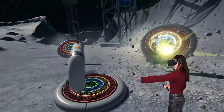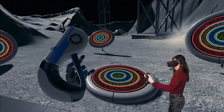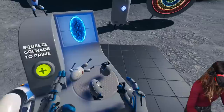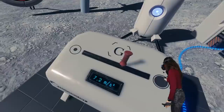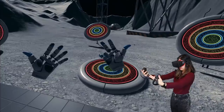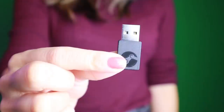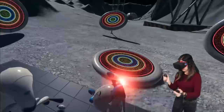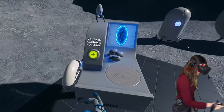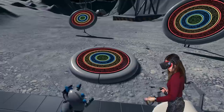So let's talk about the catch. Since the Knuckles work with SteamVR, SteamVR tracking needs to be in place. This means that in order to make this work, you need two HTC Vive base stations which go for $134 each. And then you also need something to pair the controllers with. Any HTC Vive headset has the wireless controller dongles inside, so the controllers pair with them out of the box. However, other headsets like the Pimax or Oculus Rift need separate dongles. Fortunately, there is a solution: you can get two Steam controller dongles for $13 each. However, those do not work straight out of the box with the Knuckles — you will need to update the firmware for it to work. The update itself is free and I'll show you how to do that later in this video. And then there are a couple of steps on your computer that you need to do, like installing the Knuckles drivers and getting the Oculus Rift equipment to work with the base stations.